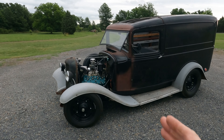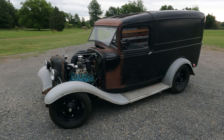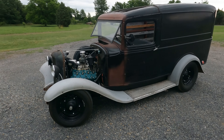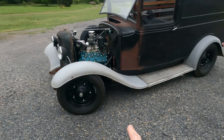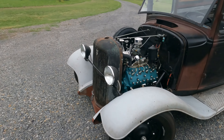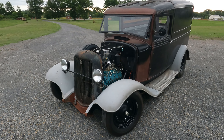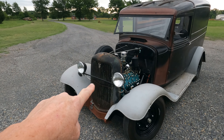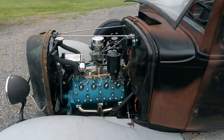This sucker is a 1934 Ford panel truck. It's basically a Ford from the cab forward, and from there back it's a whole lot of wood and sheet metal. We're not completely finished yet, but here's the rundown. We went with wide fives — 39 wide five wheels. I'm running V8-60 spindles in the front, three-and-a-half inch and four-inch in the back. We've got hydraulic brakes. The only thing we had to find was the headlight bar. Good friend Justin Boss out in San Diego had one — he didn't even know he had it. We went through his stash and pulled it out. He donated that one, so big shout-out to Justin — it went to a good home.